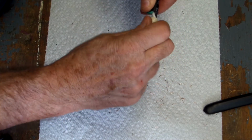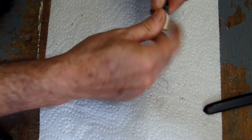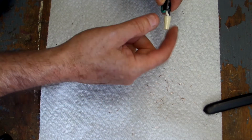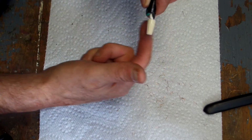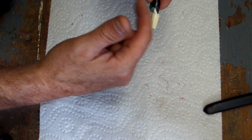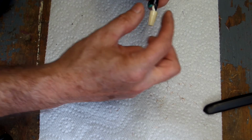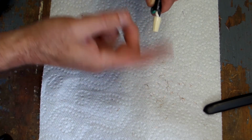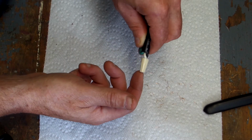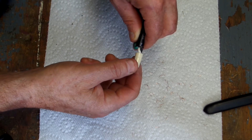When you do so, this should become very tight so that you can't hardly even turn it. So when you get it on there nice and tight, the bottom ends should be twisted together. And then finish by wrapping this all with some electrical tape. That makes sure that nothing's exposed, that you don't then get another short because you have exposed wires. Okay? Now let's show you how to continue finishing the repair on the Oreck vacuum.